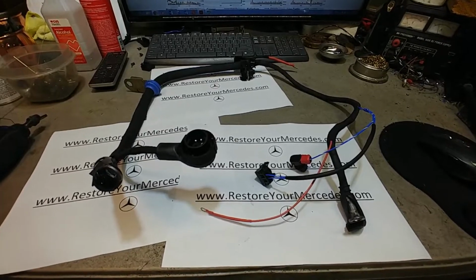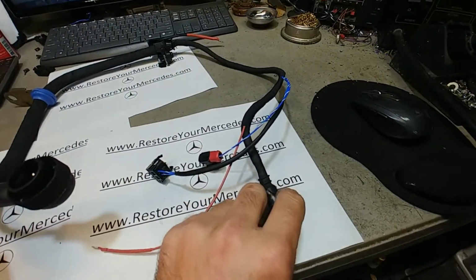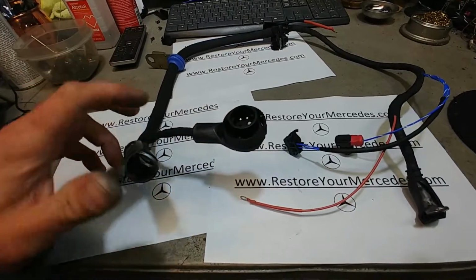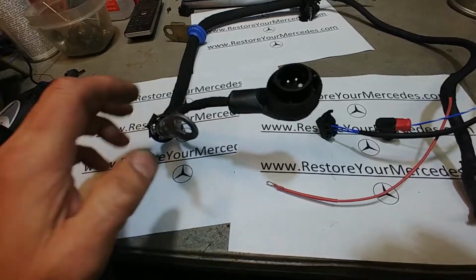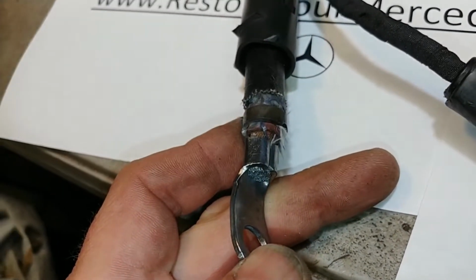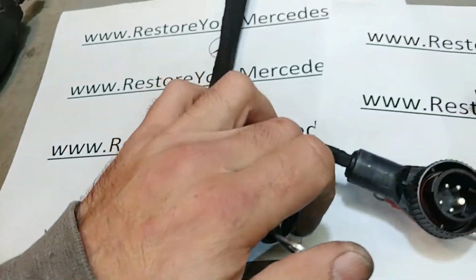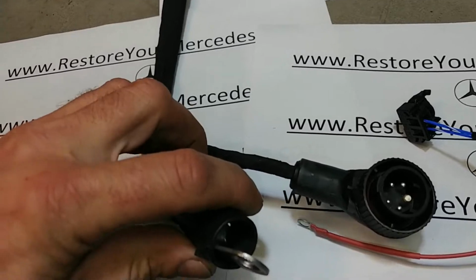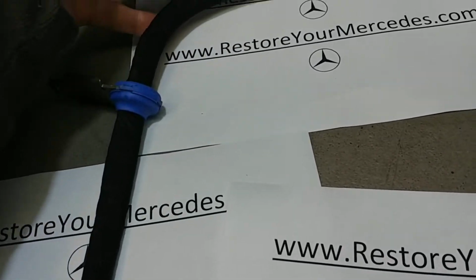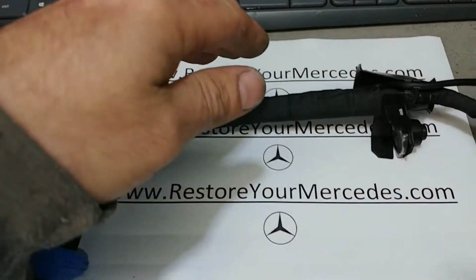Alright, so here it is. The harness is repaired, all the wires replaced, well, except for the main power lines. Those are solid. They use a completely different type of insulation. It's like a few layers. If you look closely, you're going to see that these are serious wires. These never fail. Nonetheless, everything is rewrapped, of course, so that's an extra layer of protection. Anti-friction tape, so when it rubs against something, it's not going to damage the underlying wires.